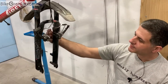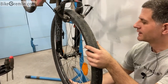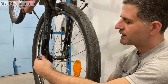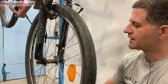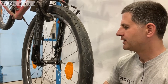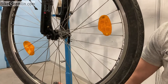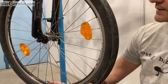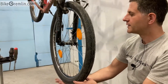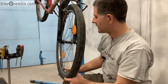You need to make sure that the tire goes clear past the brakes — that is the first obstruction you will face — and soon afterwards you will come to the dropouts. Make sure the nut is unscrewed enough to create enough room for the axle to slide past so it doesn't get stuck. Once it's in, the important thing is to make sure you've put it all the way up — not sideways or with both parts a bit down. Exert some pressure from down upwards.